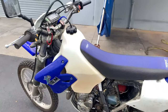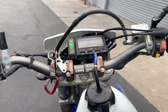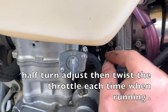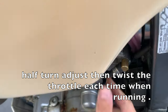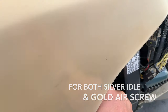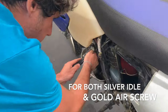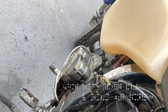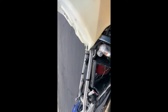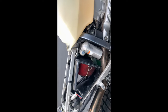A couple of tuning tips in case yours doesn't idle and set perfectly. The idle is pretty good — this is your idle right here, you just want to turn it up. Every adjustment — touch the gas. This bike's got 7,500 miles. We've got two turns out, a 48 pilot, and 178 main jet. Definitely go to a 190 — just wanted to be realistic with what we have right now.